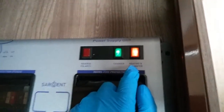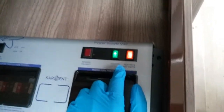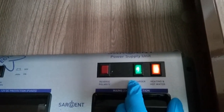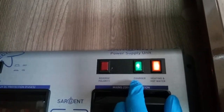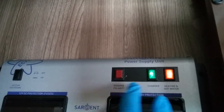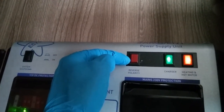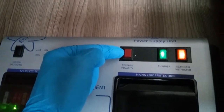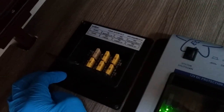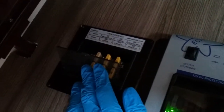We have an isolator switch just here for the heating and hot water on main supply. So if we turn this one off, again we will get a warning triangle when using the Truma heating. This one here will turn the battery charger on and off — obviously we want the charger on when we are hooked up to main supply, so again it can be left alone. This one will illuminate if we have reverse polarity connected to the van — you may find this on some continental sites. And then we have a few more 12 volt fuses just here, with a sticker letting you know what each one is for.